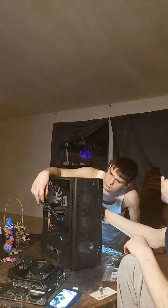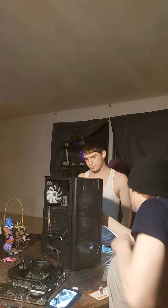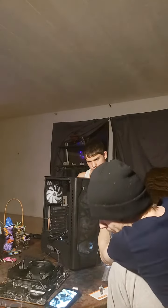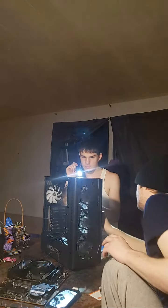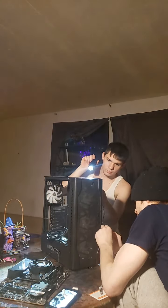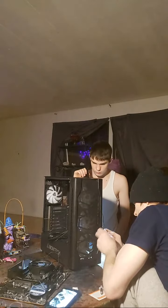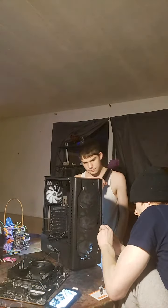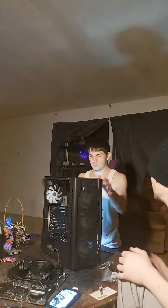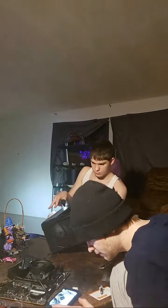All right, now before you get too excited and go about installing your motherboard, there's a couple things to mention here. First of which, if you are using an air CPU cooler tower sort of thing, like I am right here, then this doesn't really apply to you. But for those of you using liquid-cooled AIOs of any kind that have radiators, you want to make a note of whether or not it makes sense to install your motherboard first before you install your radiator. It can kind of depend. For the most part, I would say the rule of thumb is you install your motherboard first and then your radiator, but there are some instances where the reverse is true and makes more sense for that particular configuration. So you just want to sort of think it through. If you're not sure, look up the manuals to see what they suggest, or if it's not there, look online. But that is something to know.